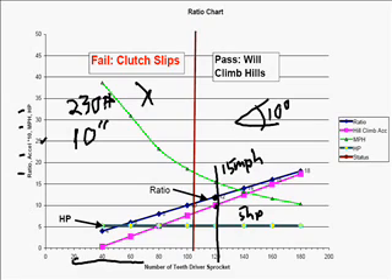This particular ratio is 12-to-1 — that's what that's saying. And what is this go-kart actually required to have for a rear sprocket in number of teeth? You would have to have 120 teeth, and here's what that actually looks like.